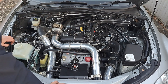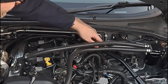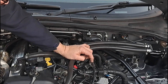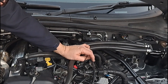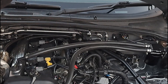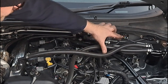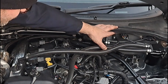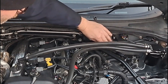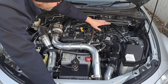The other vac line is over here — this is the brake vacuum line. I could have taken that off here but I hadn't thought of it at that stage. The brake vacuum goes across here, also directly from your intake manifold. I've also teed off into the MAP sensor — this is the three-bar MAP sensor — and that's the other vac line I've done.